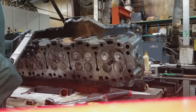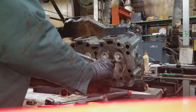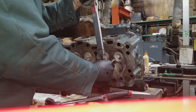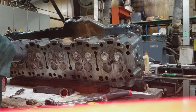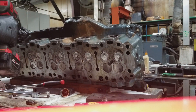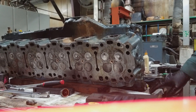Now we're installing the flaring tool, which is J5286-6. Again I'm using the drill and finishing the tightening by hand. This gets torqued to 30 foot-pounds and that's a 9/16 socket on that tool set. Unfortunately, the tool sets are getting hard to find, so if you don't already have one, you might be in a tough spot looking for one.